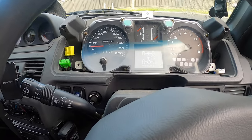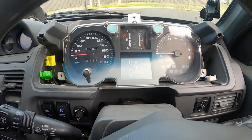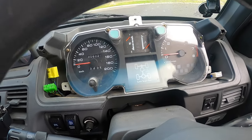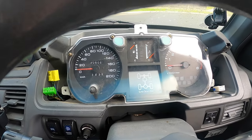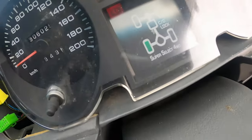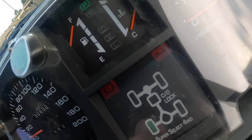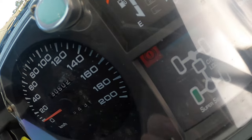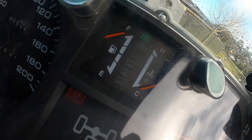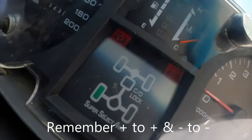We're back in the car. I've plugged all five plugs in at the back and I'm about to switch the ignition on - wouldn't it be good if they all lit up. Let's turn the ignition on to position two. So I've only got the one working down there. Those two globes up the top are for those indicators - no engine light coming on, the park light up the top works, but the others don't. That means all of those there need to come out and be spun around the other way.